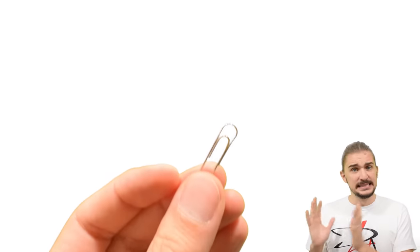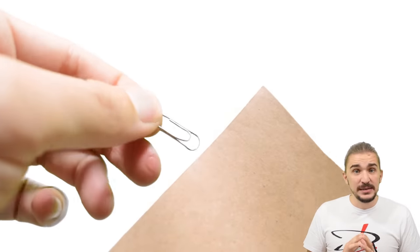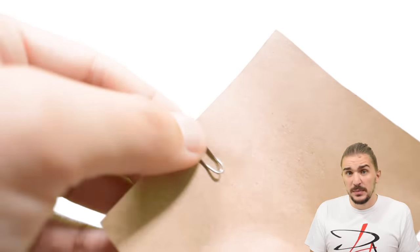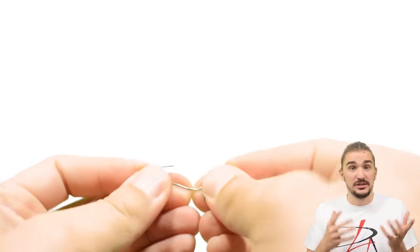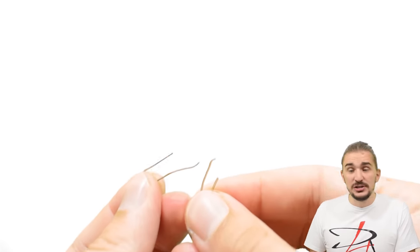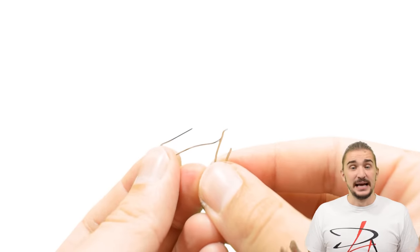To understand fatigue life, think of a steel paperclip. It's never going to fail unless you push the material past its yielding point. So if you use a paperclip normally, it's going to last forever, but if you bend it back and forth past its yielding point, it's going to fail. Steel rods are just like that — if something doesn't go wrong within an engine, they're typically going to last many hundreds of thousands of miles.